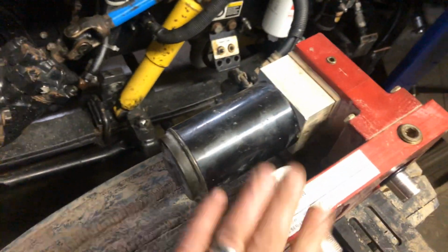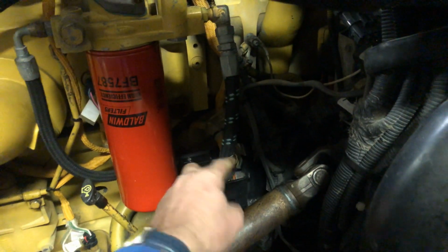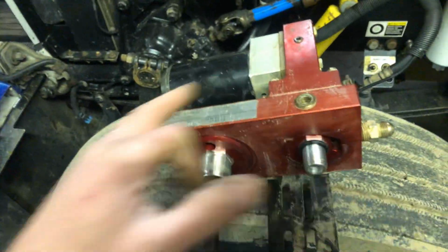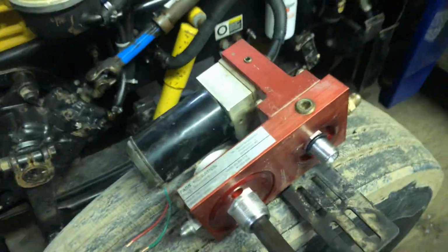So the pump again. This is returned from a Fass system because they run a separate return. This is supplies to the engine. So I'm wondering if I can cut this and put a T up here and return this fuel back in my tank. Basically what this thing does, even when the truck idles, you obviously don't need that high of a demand on the fuel, but this thing still pressurizes about 22 or 25 psi, and it's constantly running the fuel from your tanks and returns it back.